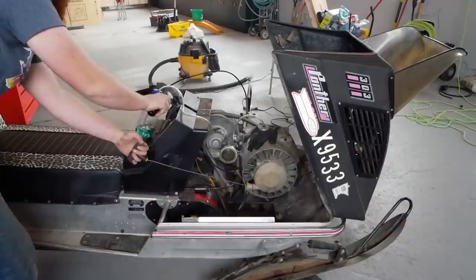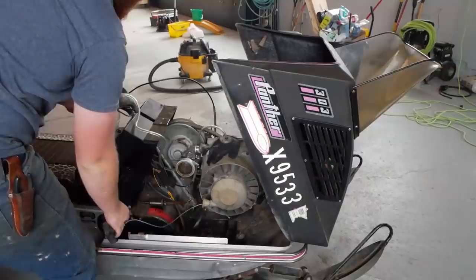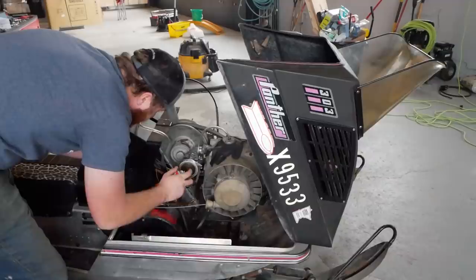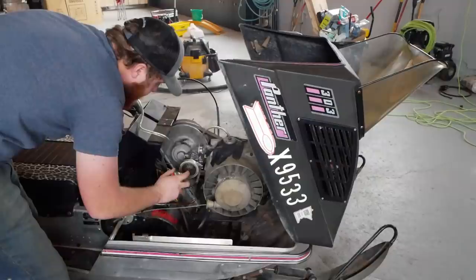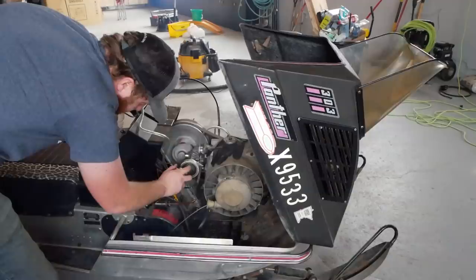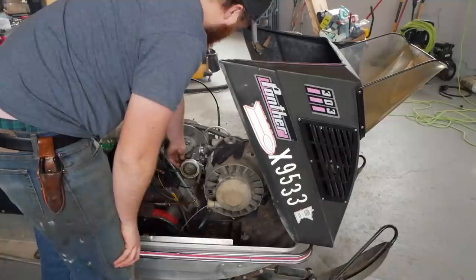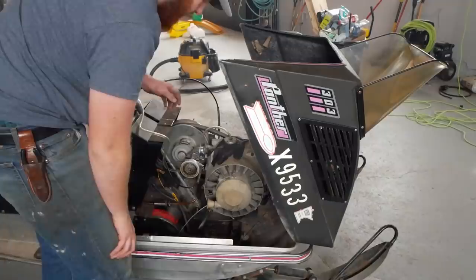Seems to be pulling fuel better. Like, a lot better. Feed it fuel, and even then it just doesn't sound like it's hitting quite right. It's quite possible there's a bad seal in there, who knows, one of the apex seals that is.